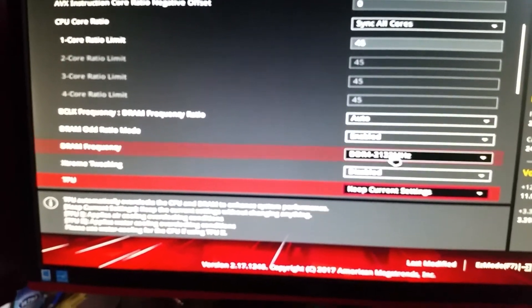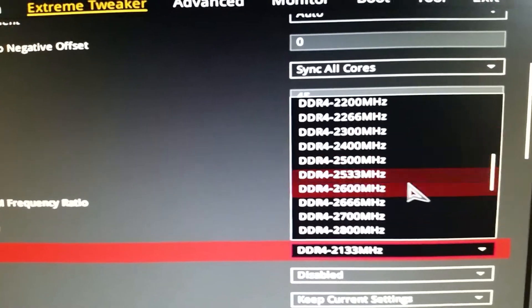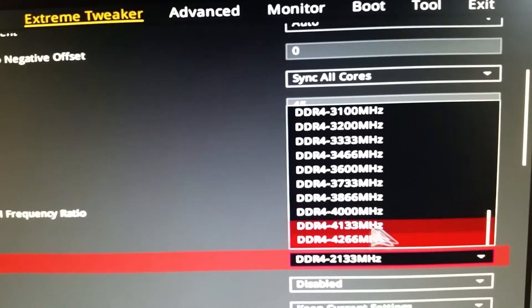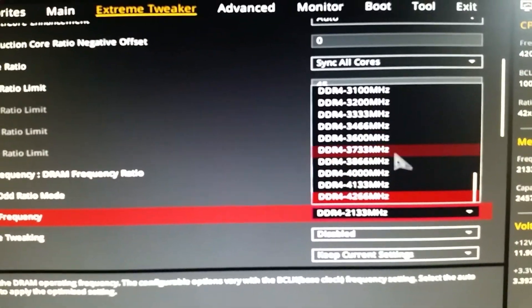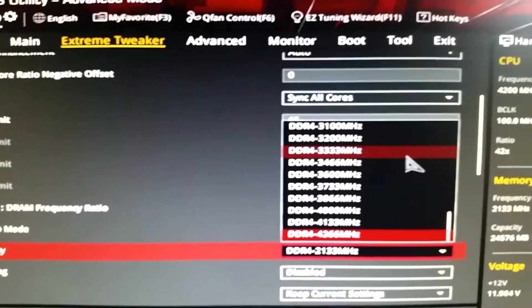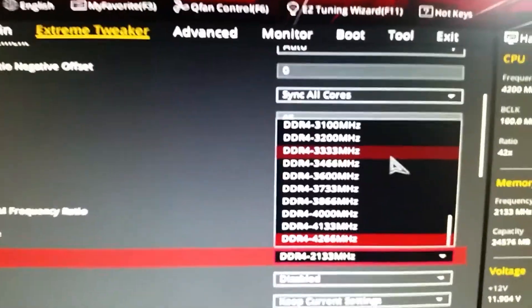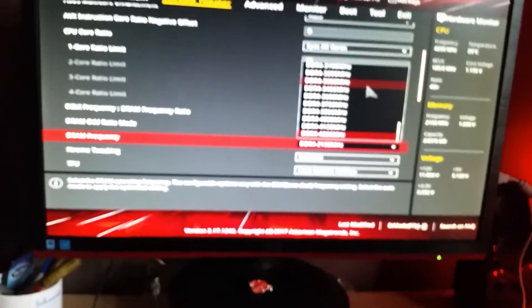It does go all the way down to 800MHz and all the way up to 4200MHz on this particular motherboard if I wanted to overclock. These will go to 4266 and I can get into 3200, though I tried 3333 — not a chance. I don't know enough about timings to mess about there. But today is a little test to see what actually boots with RAM from two different, non-affiliated companies.